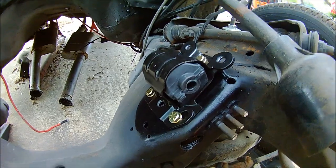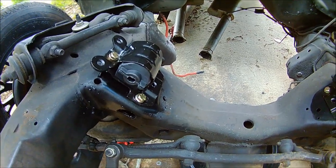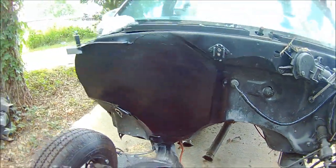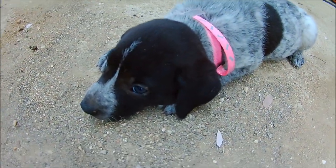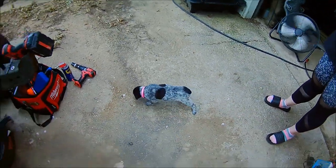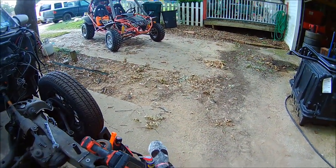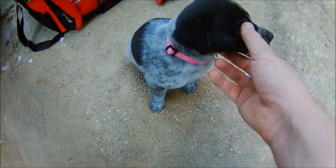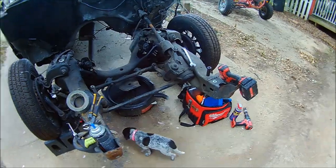I got the new motor mounts in and drilling that hole made it so much easier. I recommend to anybody doing a V8 swap in an S10 to drill holes in the frame to do motor mounts. Got the firewall finished up and we got a new shop dog today — this is Holly. The other dog is around here somewhere — he's on the porch still, he's not coming out. That's it for this video guys, thanks for watching, I'll see you next time.